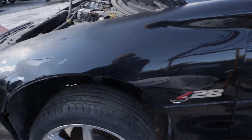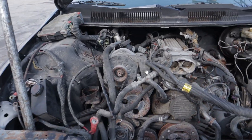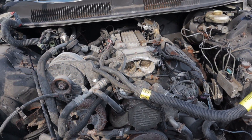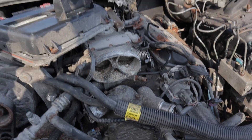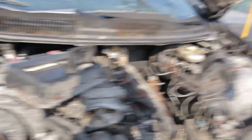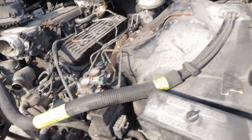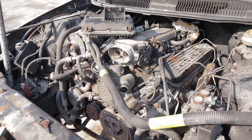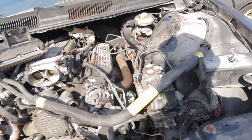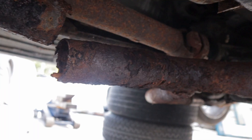I think that's it for up top. When it comes to the subframe bolts we're going to head underneath the car now. But let's recap before we go any further — you have to remove the positive and negative terminals, remove the ECU and just throw that right on top of your motor. Also, you're going to want to leave these two shock bolts intact so that the engine doesn't drop, because everything will drop once you lose the subframe bolts. You want to lower this down nice and slow to make sure if anything is pinched you can stop and adjust it out of the way.